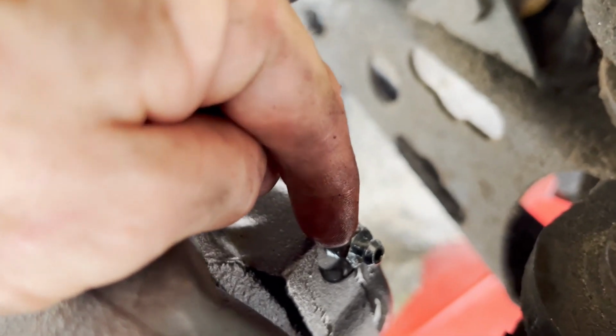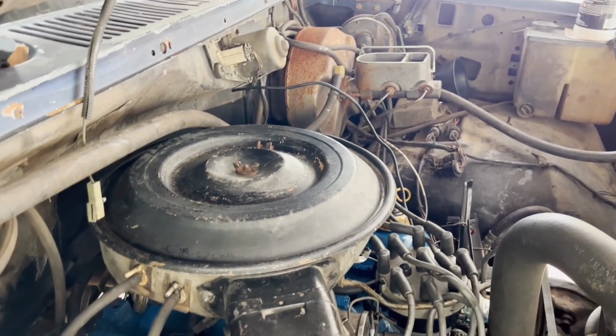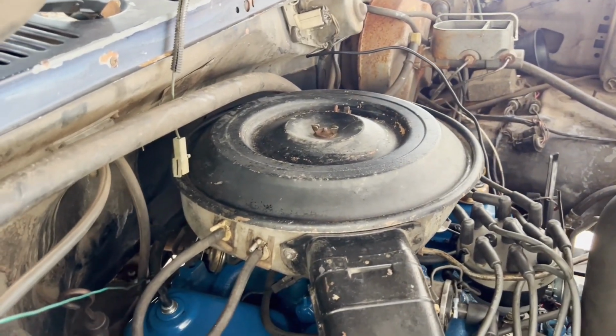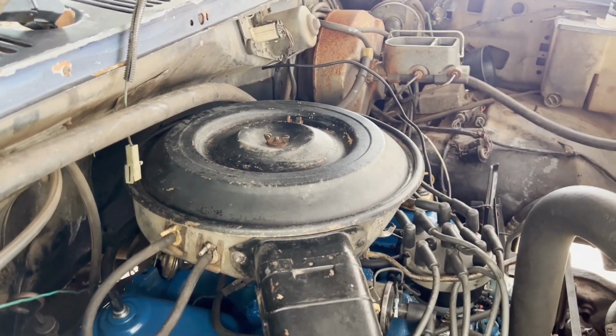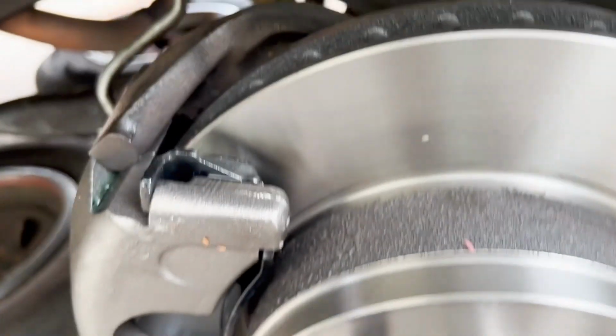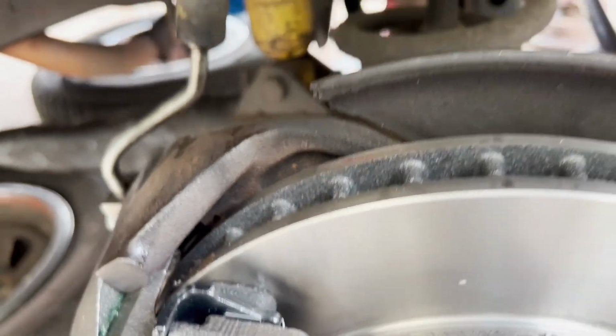Then you tighten this side down, and you monitor your fluid level. Every few pumps, take a look and make sure you're still high in the cylinder. And at some point, you will have to fill it. Now, mind you, there are better, cleaner ways. I'm doing this outdoors on an old beat up driveway, so it's really not an issue.